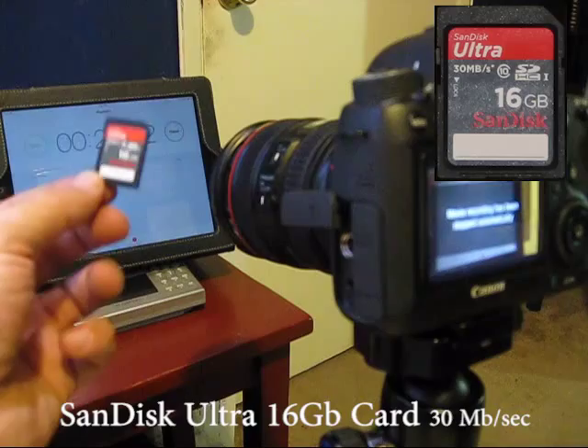This makes the SanDisk Ultra cards basically useless when you're recording low-compression HD 1080p 30 frames-a-second video. I'm actually disappointed by these cards. All the other cards, aside from the SanDisk Ultra, were able to maintain an HD 1080p video stream for quite a long time — so long that I gave up and stopped them. Even the Transcend 16 gig card, which is a class 10, held up with 1080p low-compression video with sound, much better than the SanDisk, and its buffer-clearing times were a good second faster.